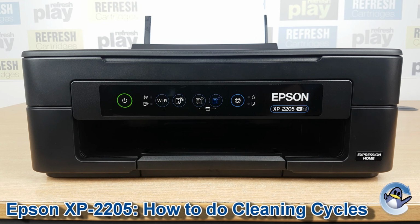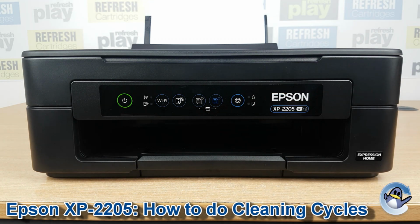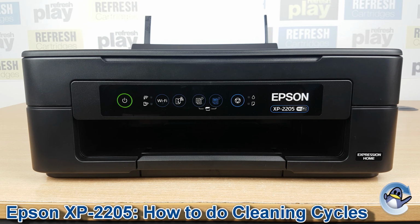As you are presumably cleaning the printhead due to a print quality issue, I'd recommend doing a nozzle check now just to check the result of your clean. And you can carry on in circles doing cleans and test pages until you see an improvement in your print quality. We have a separate video for the test pages on our channel, so I'd recommend checking that out if you don't already know how to do it.